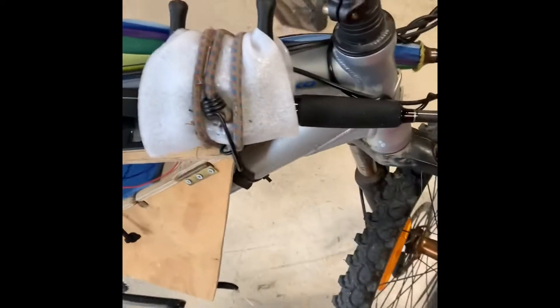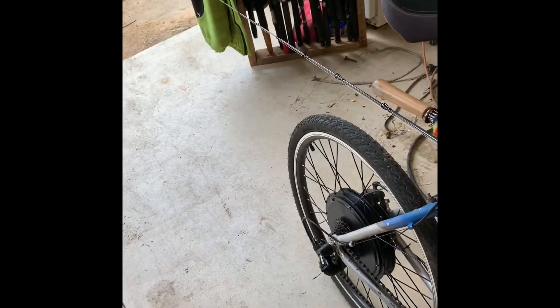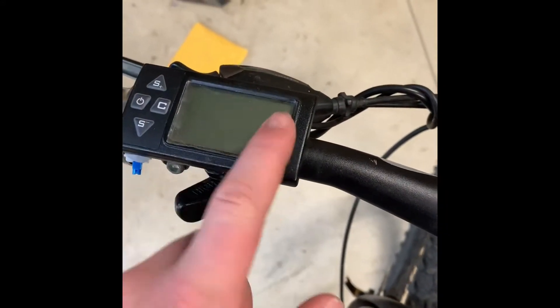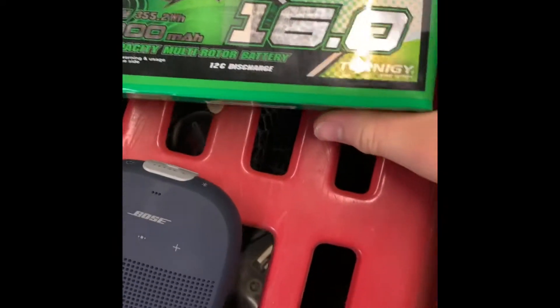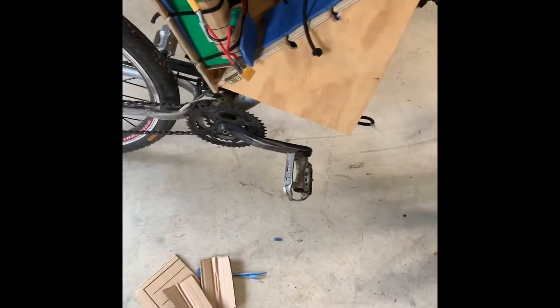Recently got myself a bait caster — a little fishing rod, I think it's a five foot eight rod. Got an umbrella in case I get wet, a little display screen for the bike system. I made up this little box here — I've got two of these 16 amp hour batteries, 22 volt each, so 6S. From my testing I've got about 14 amps out of them.